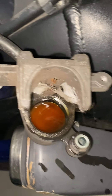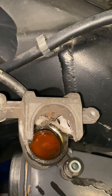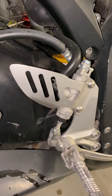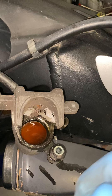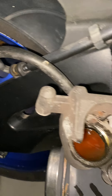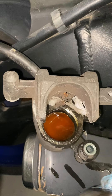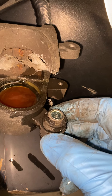I always pre-fill the slave cylinder — it's always best to pre-fill it. It's probably gonna get everywhere, so don't let it get on your swing arm or on any paint, because it's gonna eat the paint. If it drips, you have a couple seconds before it does damage — get water and wipe it down. When I'm bleeding front brakes, I spray the entire front of the bike with water from a spray bottle, just in case there's any splash, so the water absorbs the brake fluid and it won't do much damage if you catch it in time.